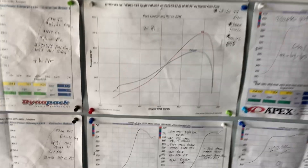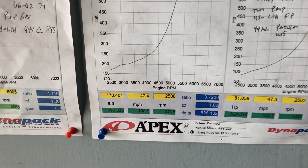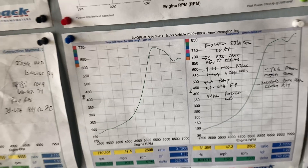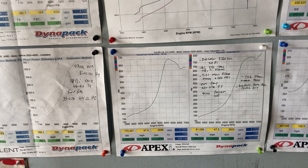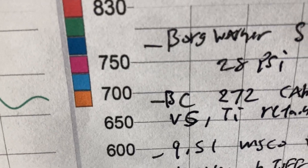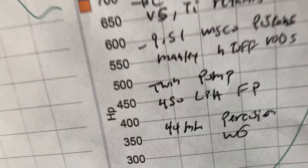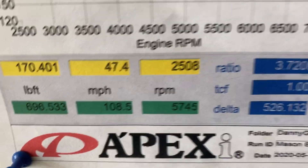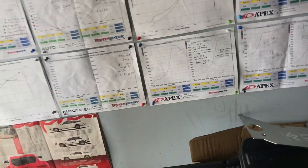Let's go into just two more things really quickly. This is our fully built 2JZ GE VVT-I IS300 — our highest horsepower car we've built on this platform — 824 horsepower, guys! That's an engine with Manley rods, CP pistons, 272 cams, valve springs and retainers, with a Borg Warner turbo at 28 PSI. 824 horsepower with 700 torque. This is not a stock transmission — it's a T56 with a McLeod twin plate and twin Walbro 450s. I believe he made 600 horsepower to the wheels on pump gas.